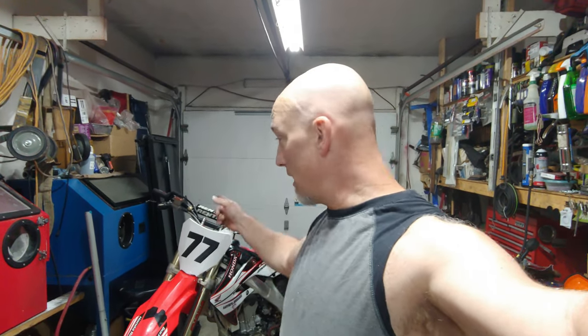I'm gonna go practice today with the kids at Twisted. And I spent a lot of last night trying to get my throttle. I got my throttle tube on, and I got the new throttle housing, but it was still sticking. What the heck? Although it was a smoother stick, it was still sticking. And I didn't find out until I put the gas tank back in. I put the gas tank back in, and it just pushed on the cables enough to where they would just start sticking again. So it was driving me crazy.